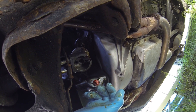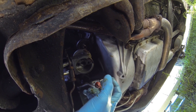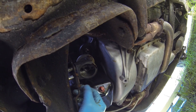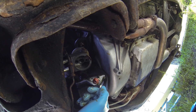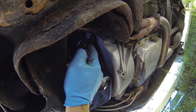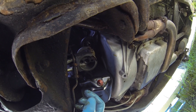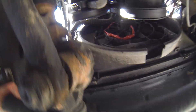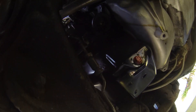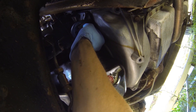I'll test fit everything before I actually fill it with oil and finish the oil change, but this seems like an option at this point. I'm gonna take this cooler right out, take the lines off the rad, and get rid of it completely. The whole assembly pops right out after you undo the two lines that run into the radiator. One of my o-rings was totally deteriorated into the rad at the bottom, and the other line appeared to have a really bad leak.